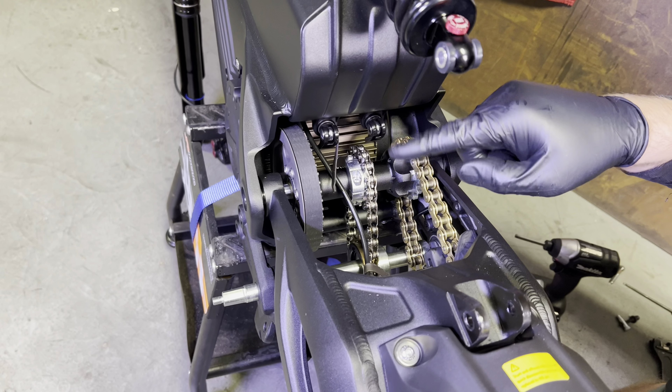The next step is to install the crank arms and kickstand, and then you'll be able to go ride. The crank arms are labeled left and right — left goes on the kickstand side. The little nuts are different on the kickstand side: they are reverse thread, so you want to install the little washer and then the nut nice and snug — this is lefty-tighty, so get these nice and tight. Otherwise they will fall off and will probably need to be replaced. We also have upgraded Luna titanium spindle carbon fiber pedals — these get tightened with the 6mm from the back. Just twist in the forward direction and these will tighten down. Get that nice and tight.